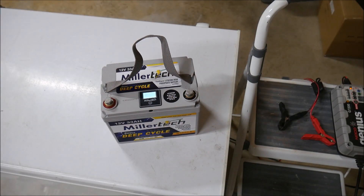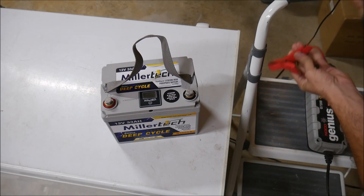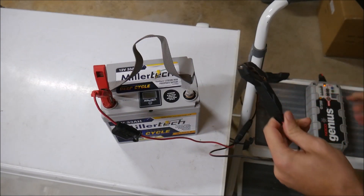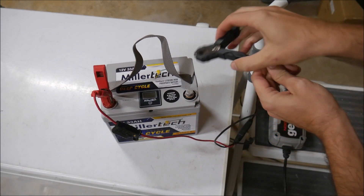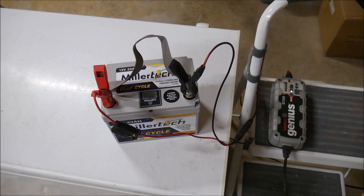As I connect the charger to the battery, you'll notice that the charger starts to try to charge the battery. That's because it senses the voltage of the battery terminals, which are still working since the battery itself can be used below zero. But as the charger tries to apply voltage and current to the battery, it gets blocked.